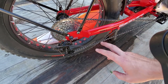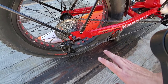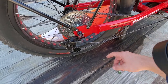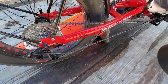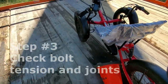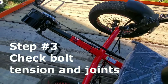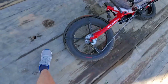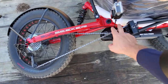Especially the mark to check — take a closer look at the chain. If you're riding and from time to time you hear some clicking sounds, not very often but you're sure you're not shifting gears, that click means the chain got damaged and you need to find that broken link. Otherwise you will lose the chain in the middle of the trip.